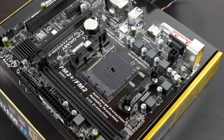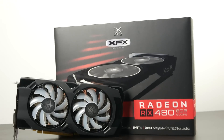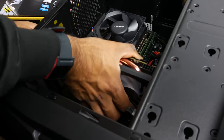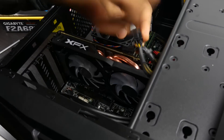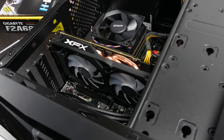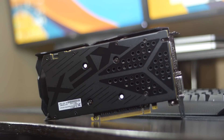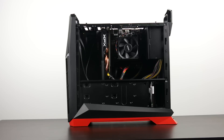If you're going to spend the most money on any part for a gaming machine, it has to be the GPU. We selected an XFX RX 480 — the RS edition, which has a factory overclock to 1288MHz. The RX 480 is an absolutely great graphics card and one of the best bang-for-the-dollar options, especially for high-resolution 1080p high-detail gaming, quad HD gaming, and even a little 4K if you bump down some detail settings.